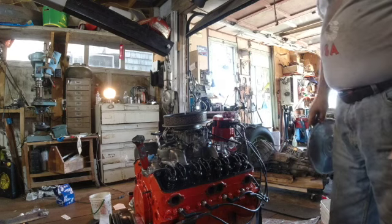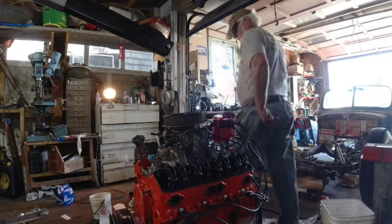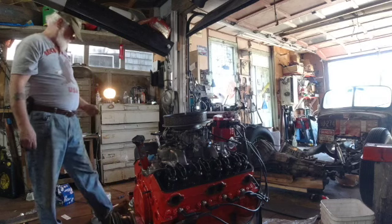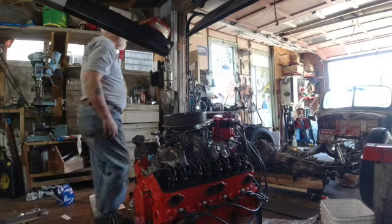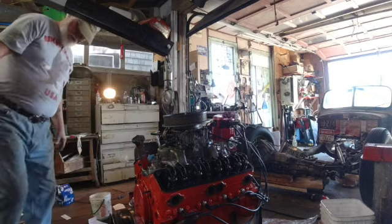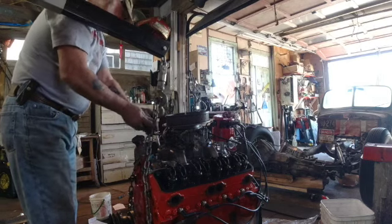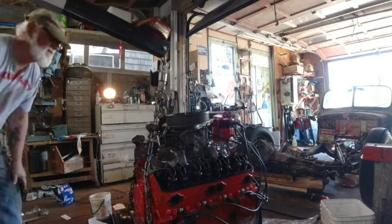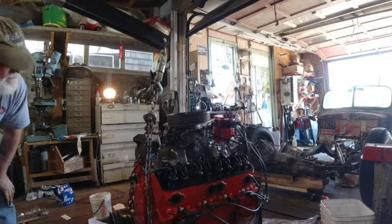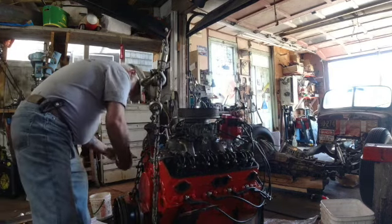Motor could be sitting higher in the front. Might be okay. Not me having to pick it up any. You have to slip a board onto the front. Can do if I want to. All I'm doing here is just leveling the carburetor. When the engine's sitting with the front end down, it's better if the carburetor's kind of level. Nice, we had it about right.